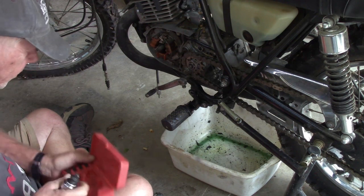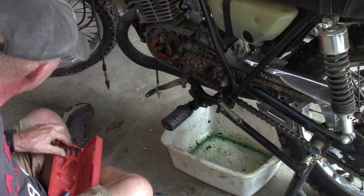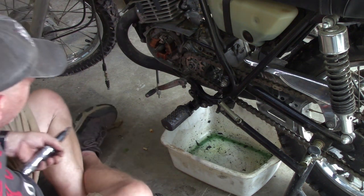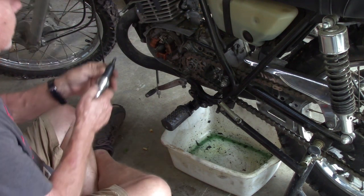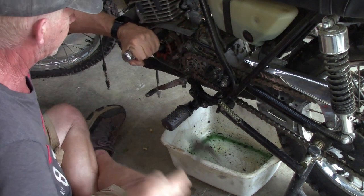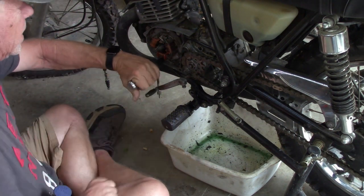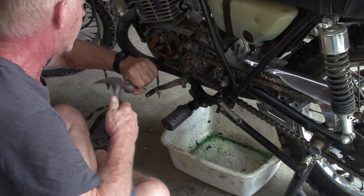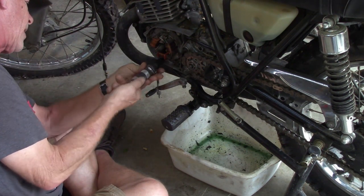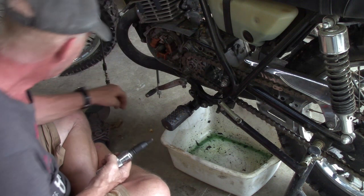You know, I probably should have just left it alone, because I think when I first got it, I was reading about 85 psi, and I thought, well, I'll just attempt to bore it out. Of course, I don't have a lathe, a mill and a honing thing like Dale does, so let's see if I can pop that loose. So I bought a tool, and it got really good reviews, and it allows you to hone out a cylinder. And I think that was my first screw up, and I put it together, and I still read about 85 psi.